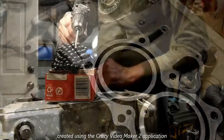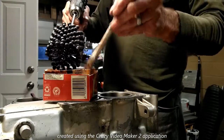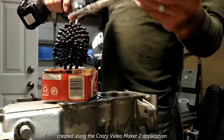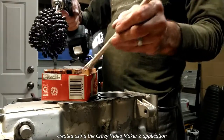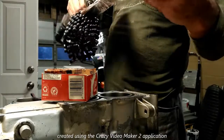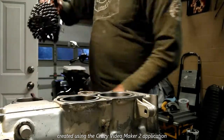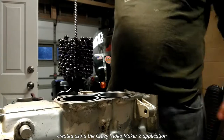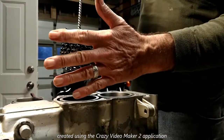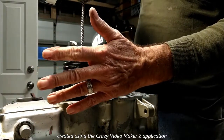The hone has to be coated with a light oil when you do this. So I'm using Marvel Mystery Oil, MMO for short. And unlike the one with the stones, you have to have this spinning before you put it in. So I put it in — it might be splattering oil on the camera, I'm going to block that with my hand. I'm going to spin it slowly at first.